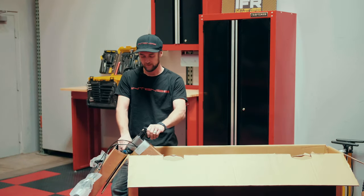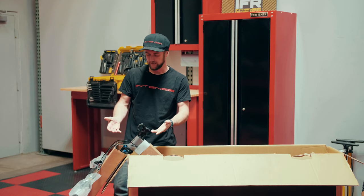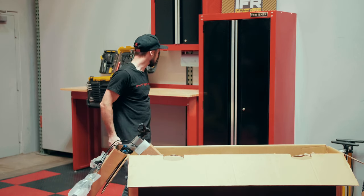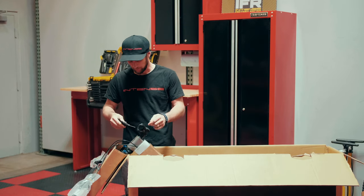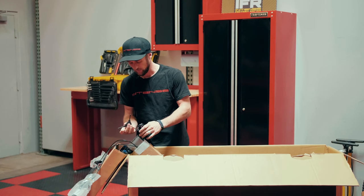Before we go through assembly, we're going to turn the stem around facing forward. This is the proper orientation — it will also be the same direction as the arch of the fork, which we'll display here soon. With that exposed, we're going to take our included three-way with the four-millimeter Allen and remove the stem faceplate bolts.